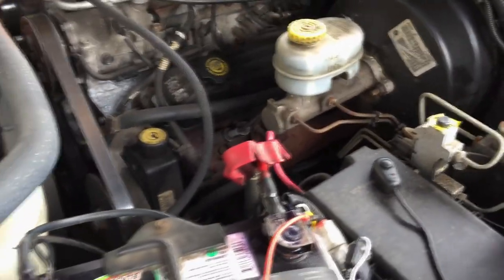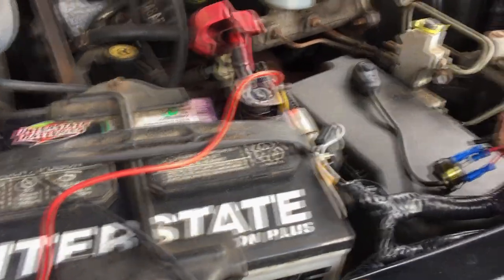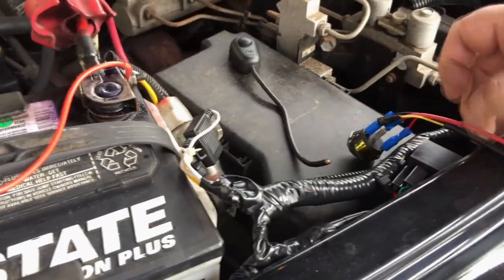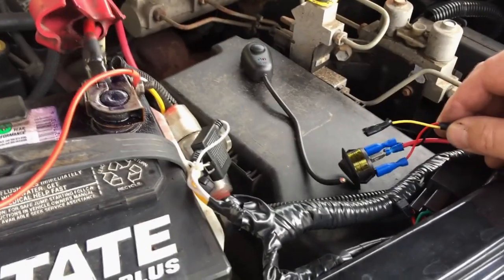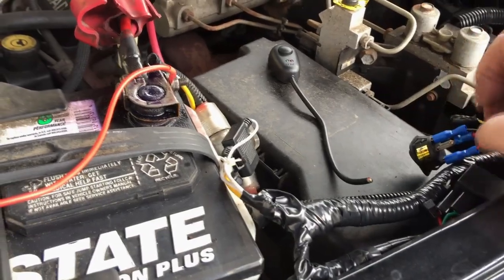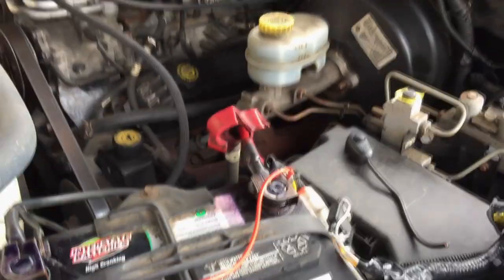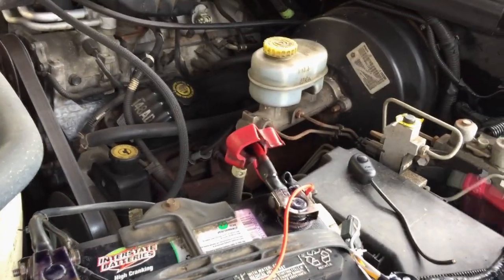So I went over to AutoZone and I bought one of these for eight dollars - regular on/off switch, just has three prongs on it. With the aux beam wiring harness, you have three cables: you're not going to use the yellow one. Red goes to positive, black goes to ground, which is clearly marked, and then you have the accessory one in the middle. I made my own cheap red wire and cut it real quick to see if this would work.